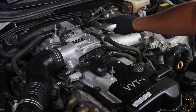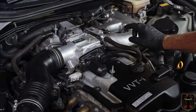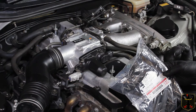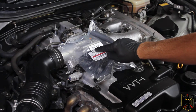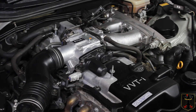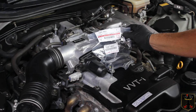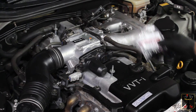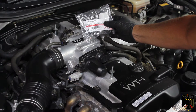I've ordered the two hoses and a new ventilation valve, and all part numbers will be in the video description. The first hose is Toyota part number 12262-46050, called a ventilation hose. The hose on the other side is also a ventilation hose, part number 12261-46051. We're also replacing the PCV valve which screws into the valve cover, part number 12204-46031.